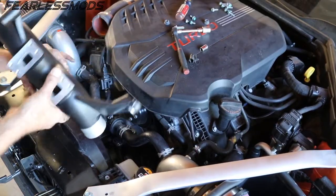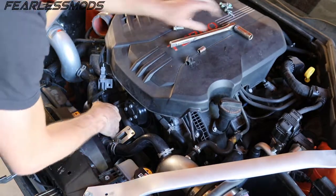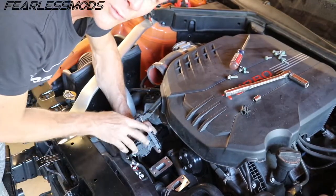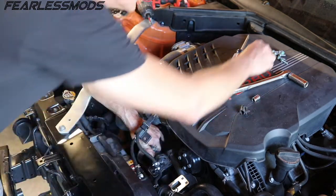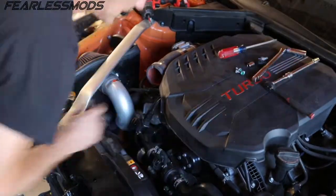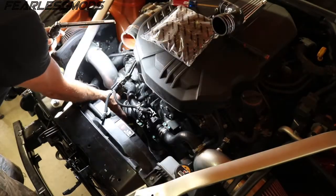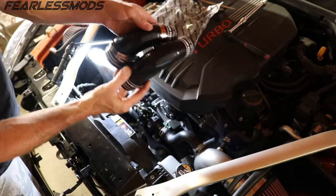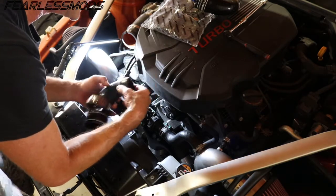From here, we're just going to go ahead and install this on the car now. That's on there — nice. It's got a little bit of flex to it. Put our blow-off valves back on here. These have just got flat O-rings, so I just want to make sure the O-rings still look good and aren't crimped or pinched or coming out of their grooves. I'll line those up and get the bolts started. Blow-off valves are installed, as is the charge pipe. Next thing we're going to do is go ahead and put on these two tubes here. Took off the old ones, and now we're just going to put the new ones on. As you can see, they go from small to large and are slightly different. Make sure you get the worm screws pointing the right way so that you can have easy access to tighten them.